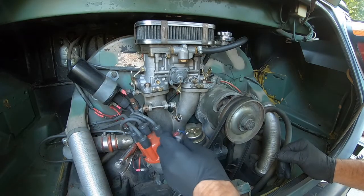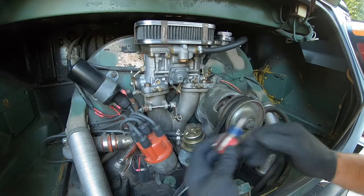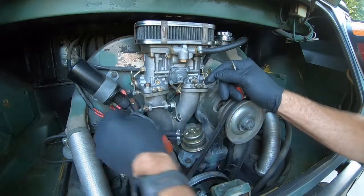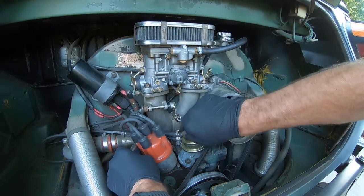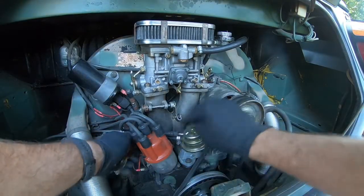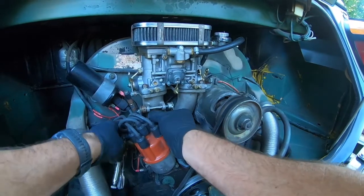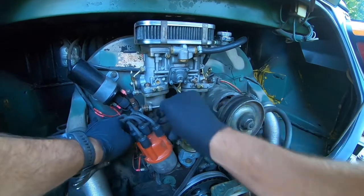The incoming gas line goes to the top of the fuel pump. So you're going to want to loosen that clamp, and then I've got a small vice grip on there, and hopefully that'll slow the flow of any gas while I plug this. All right, it took a little bit of doing, but I was able to get it loose enough where I think it's going to pull off. And if you keep this facing up, you can often feed it through without too much gas leaking out.